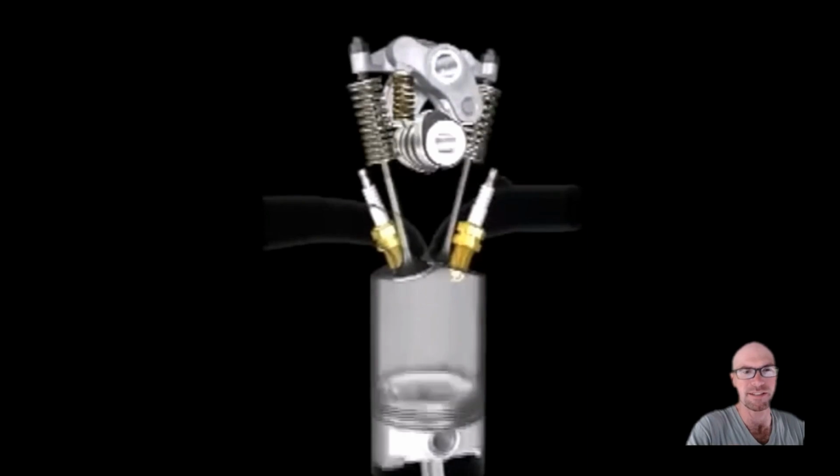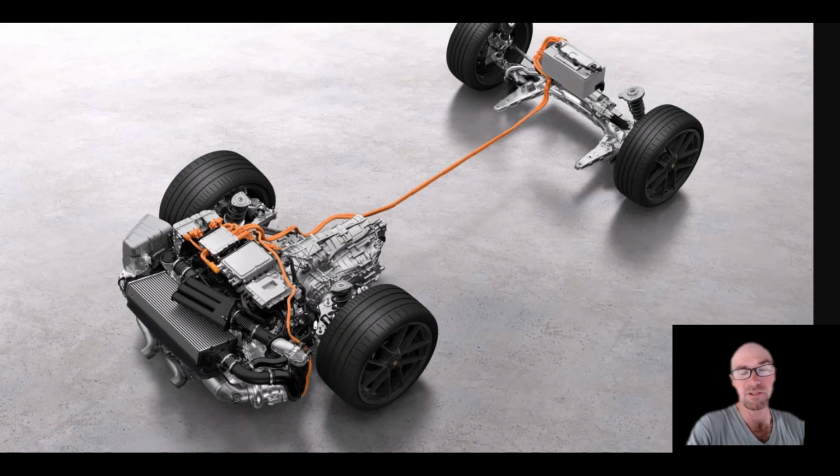I mean, we're talking, like I said, this battery is less than 2 kilowatt hours. That would give you like a couple of minutes. It'd be a total waste, and you'd have to charge the battery back up and use a bunch of fuel to do that. So basically this is just to get a little bit of regeneration. The Germans like to call it recuperation. So when you're slowing down, you can feed power into the battery pack.